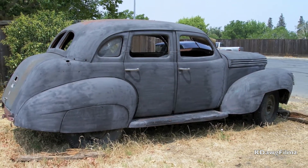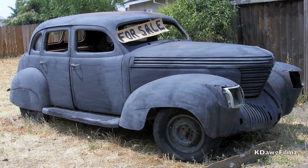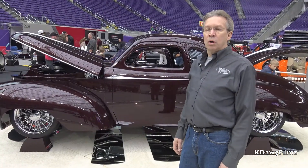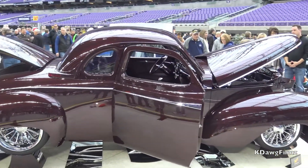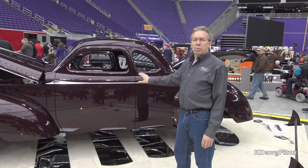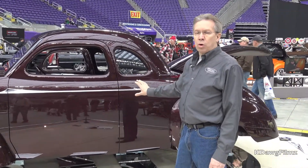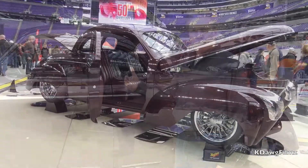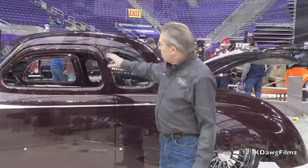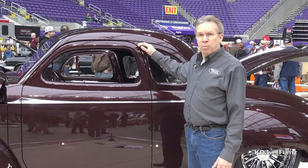Graham had plans to build a traditional two-door coupe, but the sales just weren't there enough, so they never went into production. So basically what we did is we crafted a two-door coupe out of a four-door sedan. We built the doors first. We removed the rear doors and extended the length on this particular door, and we also converted this to a suicide door. In our conversion process, this portion of this door actually was from the rear door.